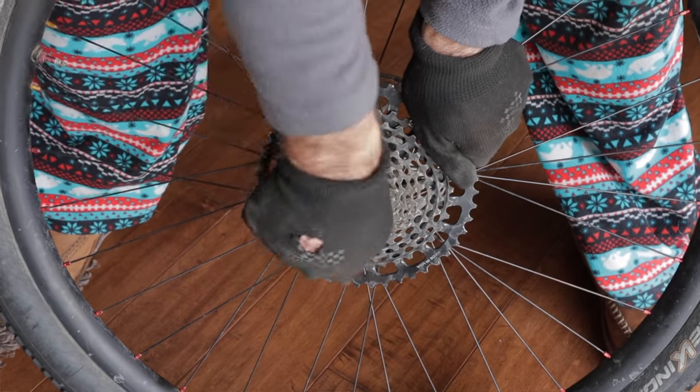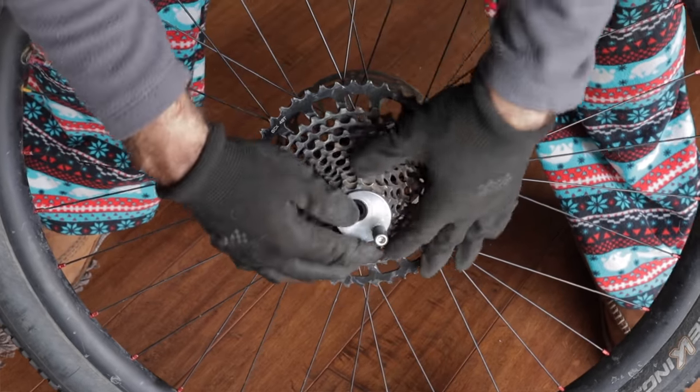Get the drive-side pedal to 3 o'clock and start slowly pressing the pedal while lifting against it. It may take a few tries, but eventually it breaks free. Once it's loosened, with the XD driver it's best to turn it a couple more revolutions before pulling the wheel off — it's still not as easy to hand-loosen as a traditional lock ring. There's more friction with anti-seize than grease, and XD drivers have many more threads than traditional lock rings. Remove the reacting pin and take the wheel off the bike. Now use the tool to unthread the rest by hand — reinstalling the pin helps a lot for added leverage.